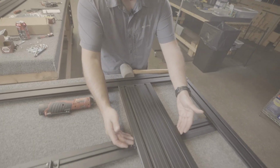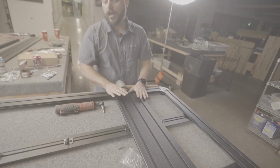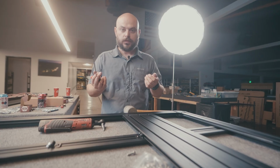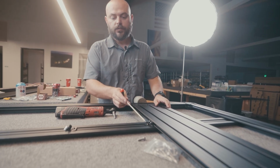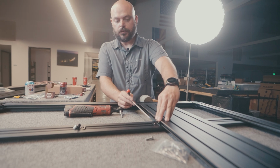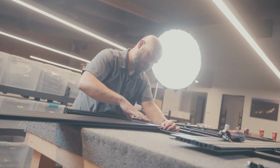And then from here, we're ready to start tightening all of our fasteners all the way down this track, and then move on to the other upper mounting deck at this point. All right, one thing I forgot to mention is the order of operations here on which ones to tighten. Tighten the 2 of them, the 2 first, and then move on to that bottom. All right, once you finish that side, go ahead and move on to this side.